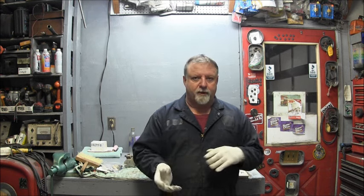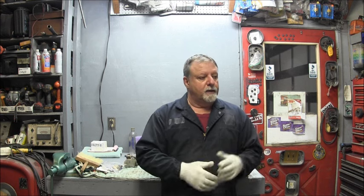So we're gonna get back on that and see if we can get it back all in one piece and put it back to use as a good outboard. That's what we are going to do. You understand? So on this little 5 1/2, there are some things that are kind of quirky. You have to pull the power head to put a new impeller in there. Wasn't my idea. But that's not a big job on one of these little guys. So then you have to drop the lower unit, do the impeller, pull the power head, stick everything back up.